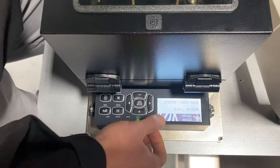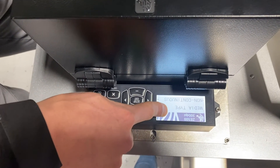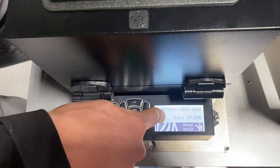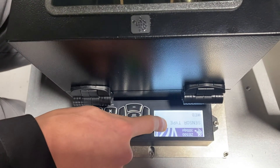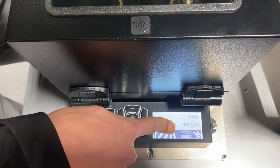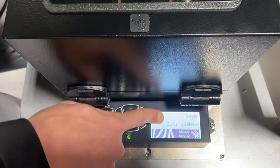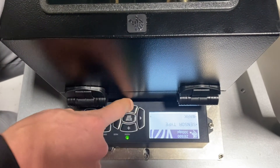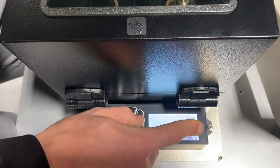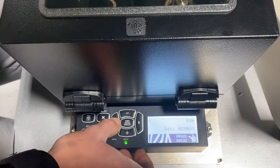Media type — we have two options: continuous or non-continuous. 99% of the time, people are running labels that have gaps in between them, so we want to run non-continuous. It means it's not just one giant long label or piece of paper. Sensor type — web or eye mark. Mark is going to be when you're using clear labels; you have a black eye mark in between each label to tell our sensor we've got a gap. If you're using plain white labels, paper labels, or poly labels, I'm going to use the web sensor and just sense the difference between label and liner, and liner only.